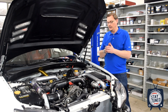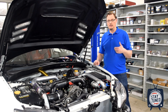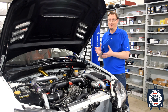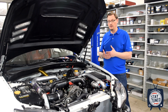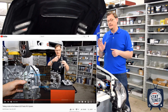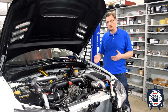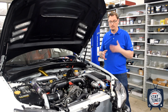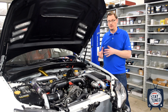Before I dive into the specifics of the fixes, I want to touch on a question we get somewhat often because of all the videos we've made on air-oil separators and catch cans over the years. The question is: why didn't Subaru put an air-oil separator on the car from the beginning? And it's a trick question, because Subaru actually did. It's easy to overlook, but there is an air-oil separator on these engines from the factory - it's that back cover plate. That's why you don't have a lot of PCV and oiling issues at stock power levels driven on the street. Those issues start to come up as power increases and as you start driving on the track with more side loads. That's where aftermarket air-oil separators come in, which basically sit on top of the factory unit and provide a larger volume.